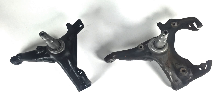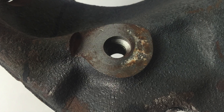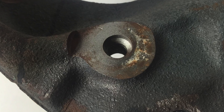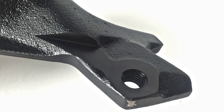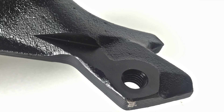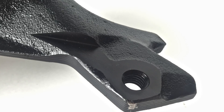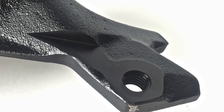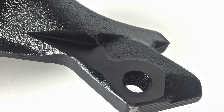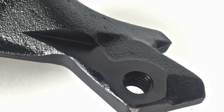One of the other things that is great about the modifications is it minimizes track width change. And as I mentioned, verifying the surfaces are flat is very important. Just look at that difference after — the machine makes it flat and very smooth. This is critical because if the caliper is mounted crooked over the rotor, it could cause a number of issues, including uneven pad wear, piston cocking, brake drag, and possibly inconsistent pedal.